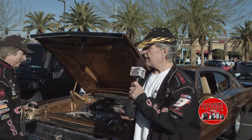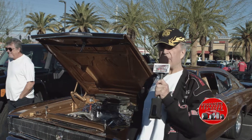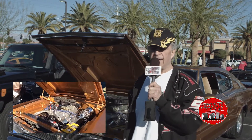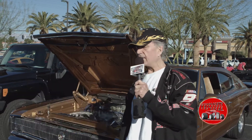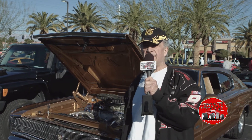Well, thanks, Ed. I'm really happy to be here. This is a 426 Hemi that got stroked to 472 and then we did a 30 over. It's got aluminum cross-ram induction, two Holley 770 double pumpers, and it's actually a five-speed car. We've got a DTS rear end. I got disc brakes on all four corners and a stereo system.